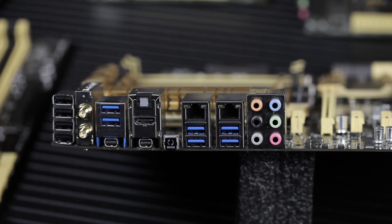The other really big change is the CPU itself. For most of you it's probably not going to hugely impact how you work with the motherboard, but we have what's referred to as the IVR — the integrated voltage regulator. That's a pretty big change because you're taking essentially all the power regulation technology that used to reside on the motherboard and putting it inside of the CPU, which means there are some changes in how you tweak, tune, and adjust the platform.